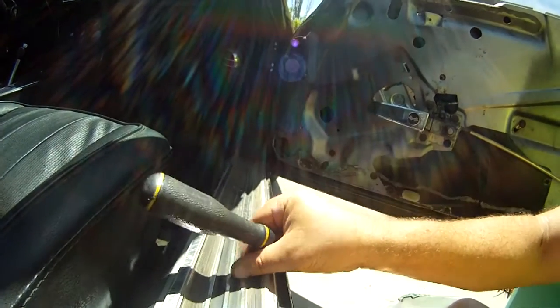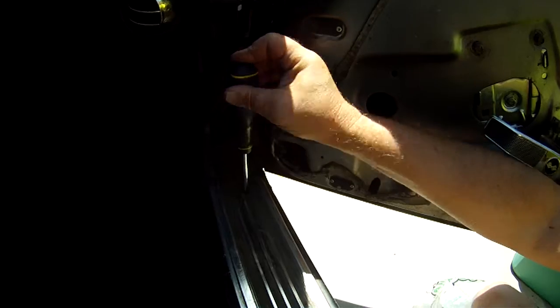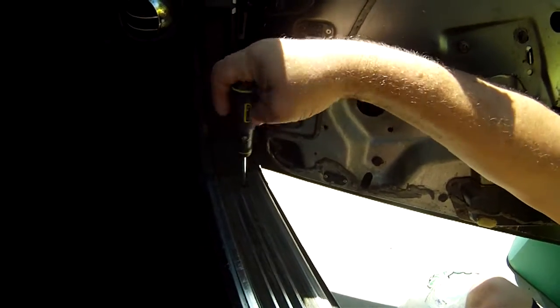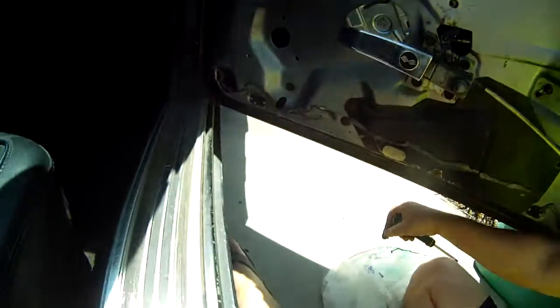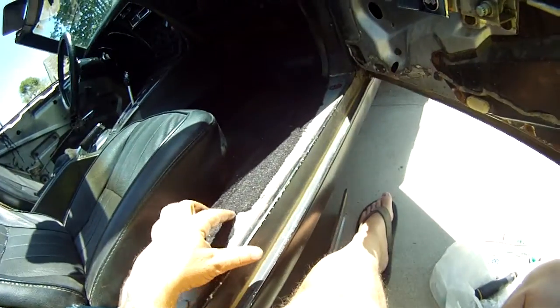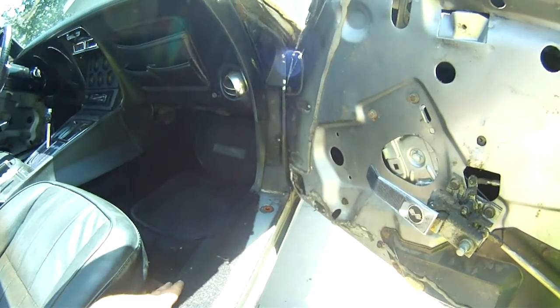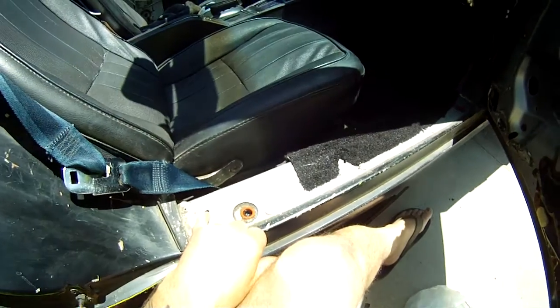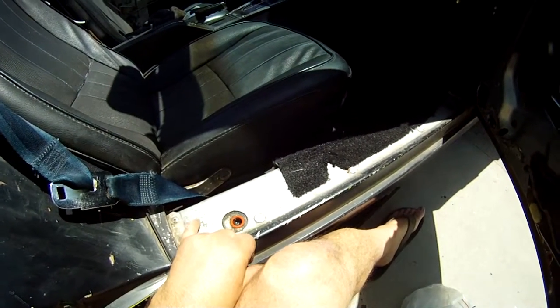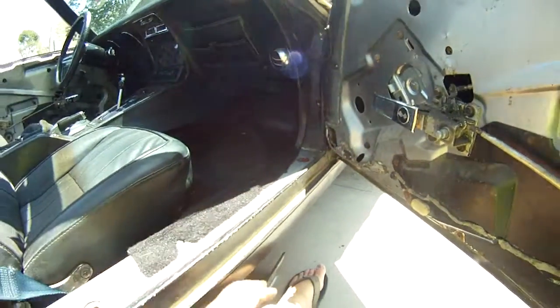This is missing one of its screws. That's screw number two, screw hole number three is an empty socket, and screw number four. There's a neat little video by 76Vet where he shows that these screws screw into fiberglass, and often times the screws will strip into that fiberglass and no longer hold a tight fit. So he takes a zip tie and tucks it in there, then screws in on top, and that screw goes into that plastic zip tie and the fiberglass — and it holds.